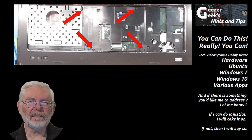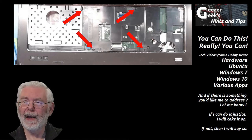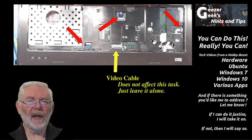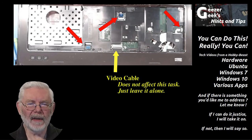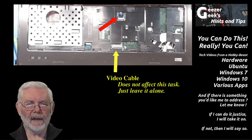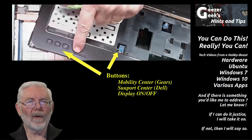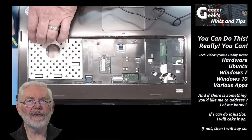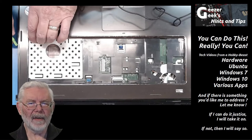Release the cable. Once the keyboard's out of your way, there are four more screws to release — on this model that's what it is — and three more cables to release. The video cable with the yellow arrow does not need to be released; it's unaffected by this task. The other three do need to be released to get the bezel up off the bottom: one for the power button, one for the touch pad, and one for the three special-purpose keys in the upper corner. Once you release those cables and pull those screws, it's time to start working on the bezel itself.